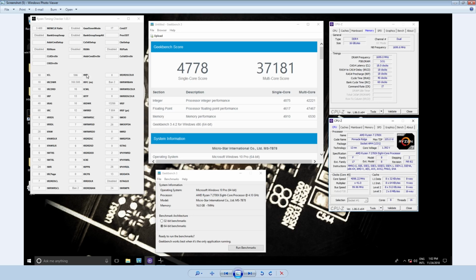So yeah, the TRFC here is just whatever the motherboard went to, because quite frankly, trying to push that down was not being very productive. Generally, I couldn't run it that much lower than what the motherboard defaulted to anyway. So that's great. Huge fan of that. TCWL still runs 2 down from TCL, so that's okay, but not great. And just generally everything was just garbage. And the performance reflects that, right?